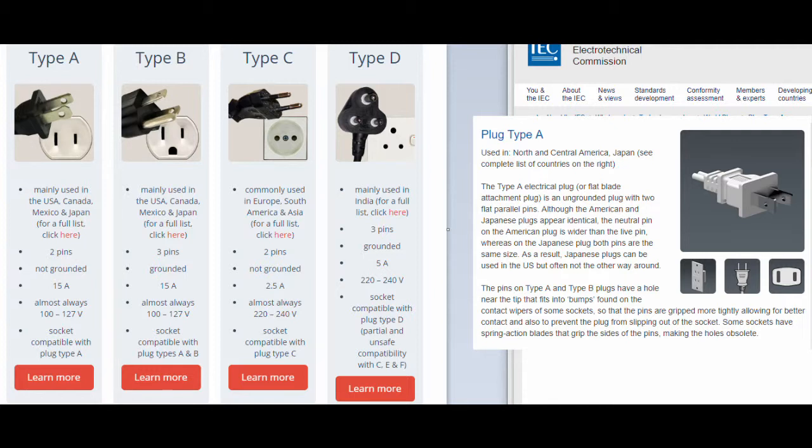I think also that the charger itself has some noise inside, it sounds like there's a loose screw or something. So either the charger is defective, which doesn't make sense, because then it wouldn't work in the wall socket. I think what's happening is that the generator does not like the fact that there's no dedicated live and dedicated neutral in this plug. The plug is not a Type A where there's... let me extend this clip. Okay, so sorry.